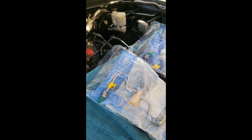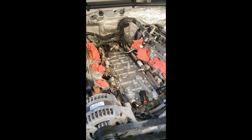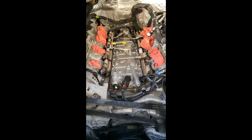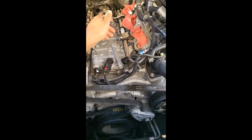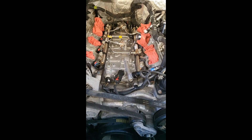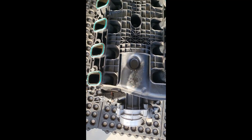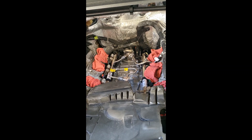The rail is back in and I'm showing the cross-member fuel lines that connect the right rail to the left rail. GM strongly suggested replacing these cross members with new ones — the old ones cannot be guaranteed not to leak and new ones seal better. I used new cross members and reassembled with a 17-millimeter wrench, just the reverse of disassembly.